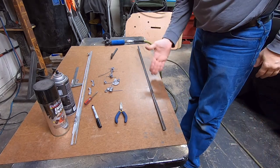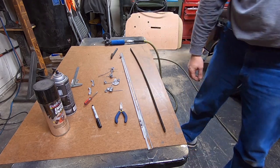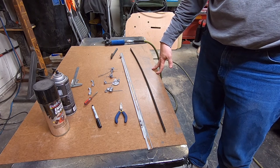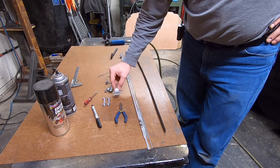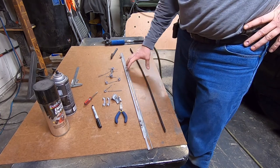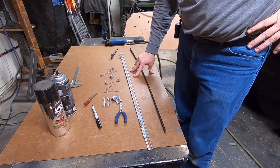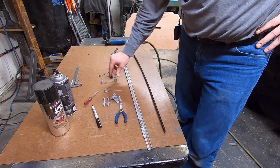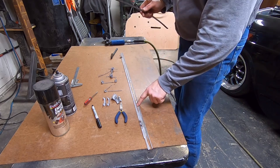It's just lots of little tedious work — almost like I'm back working on jewelry again. You really gotta pay attention. I'm gonna finish grinding this out and get it to where it fits down in that channel, then blast it, and at that point all the other pieces are blasted so I'll be able to paint. I still need to figure out a color, but I may do these plates black and the brackets in stainless steel. When I paint something I like to have different colors so when it's finished and put together it looks like a brand new part. I might do flat black on the plates and gloss black on something else.